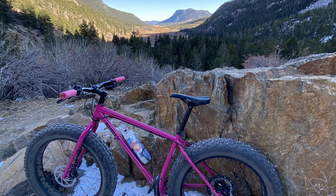On the con side: probably the most obvious is the weight. My bike as it sits - large frame - is just under 35 pounds with an aluminum bottle cage and pedals. It is a steel frame bike with large 4.8 inch tires, so I'd definitely recommend setting it up tubeless, though even then it's still on the heavier side of the fat bike spectrum. The other con, which I already touched on, are the brakes. Depending on the terrain you ride, it may never factor in, but for the riding I do out here it's the one stock spec item where an upgrade would really benefit the bike.